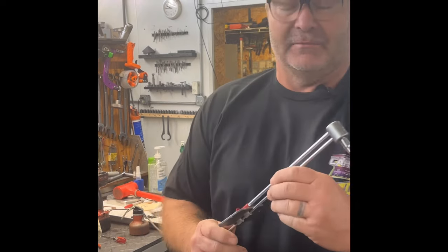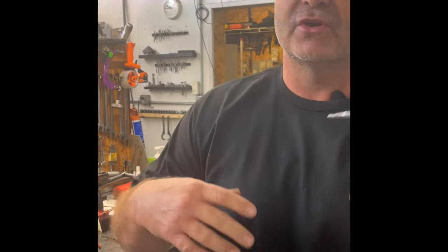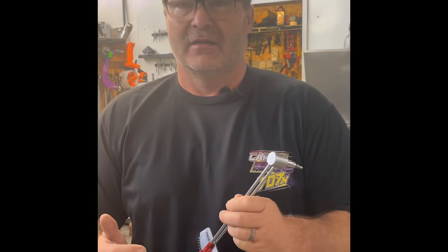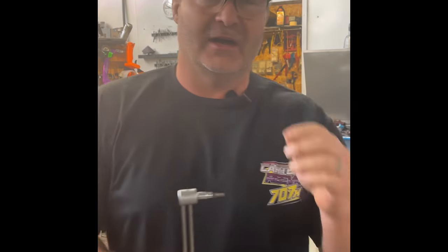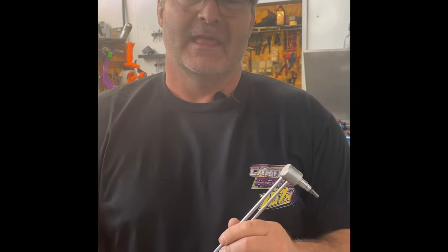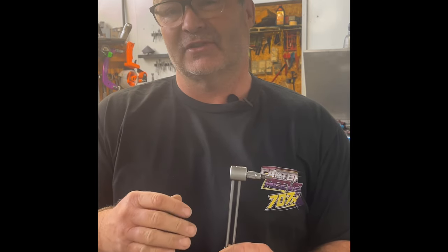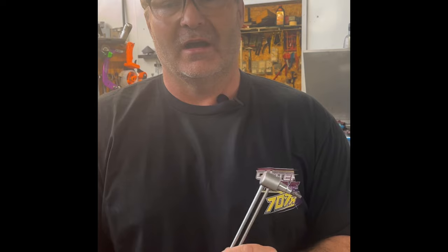I'm just going to show you how to check your spring tension. In the past, we always ran high spring pressure — I mean 65, 75-inch-pounds — and we've been playing around with that. Lately, I've been finding out that 45, 50, 55-inch-pounds is actually going to make your car quicker, a little bit faster ET.